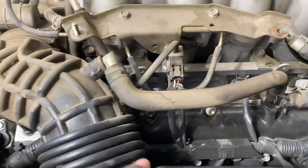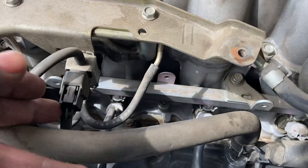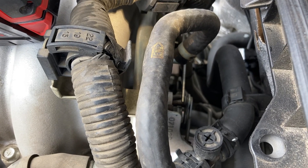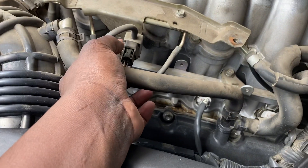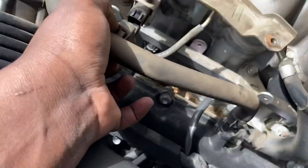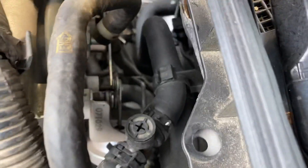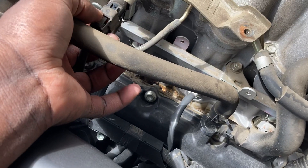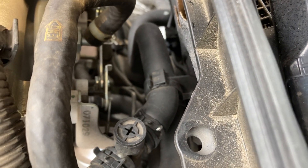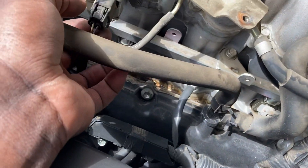There are two things that can mess with how your VIA system works. One: if this solenoid is not working well — this one right here — watch what happens. So right now it's in neutral. Could you put it in reverse? You can hear the car sounds different. Put it in park. So you've seen it. Now I'm going to disconnect this and see what happens. It's open, right? Disconnect. Did you see that? I disconnected it and you can see that it went back down. So I'm going to reconnect it — he's not messing with the gears at all — just watch what happens. And it connected. That's one of the things that can mess with how your VIA system works.